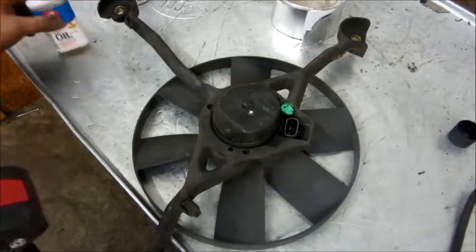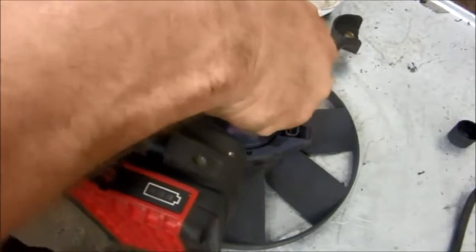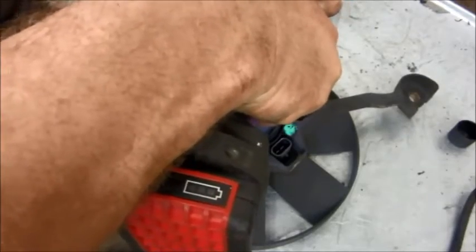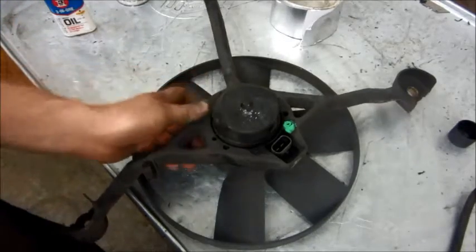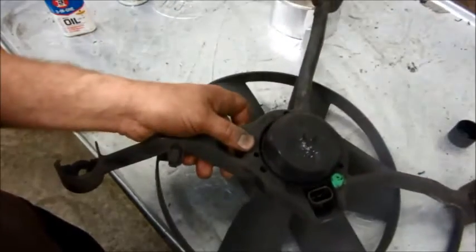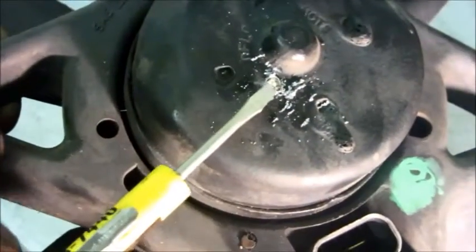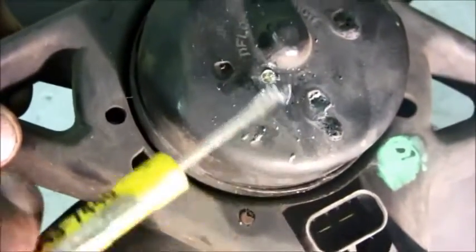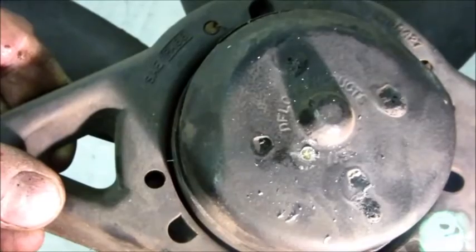That bit was too dull, so I'm going to try another one to drill through there. I got a dimple so I'm going right back in the same spot. There it is. Now if you see down in the hole — I'm going to get a light so you can see it — you can see that little bit of felt material coming out? That's the actual oil wick for the motor. It keeps metal chips from falling down in there and causing a problem too. That is what is going to be saturated with oil when I put the new oil in.